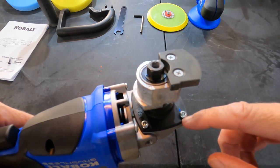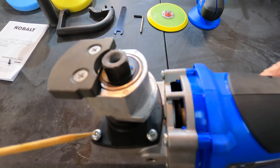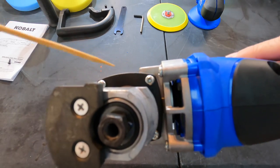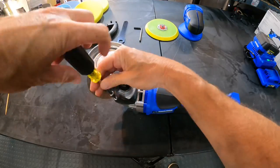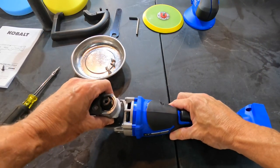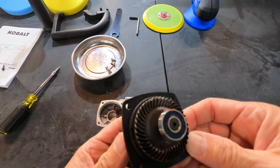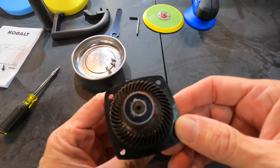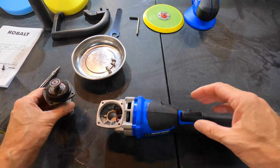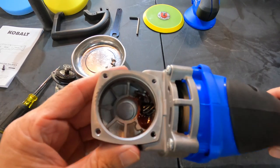So if you have a polisher that comes with that backing plate, the counterbalance is weighted for the backing plate it comes with and also pads that they sell with it. If you change them out, which you most certainly can, and it's a good thing to experiment, you may throw off the way the polisher performs. There may be different sounds and vibrations and feelings and performance and results if you change things up. I just want you to keep that in mind.